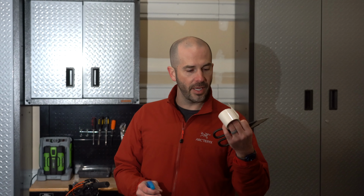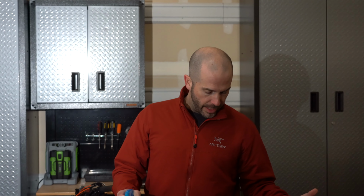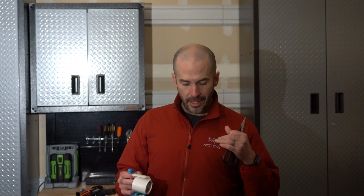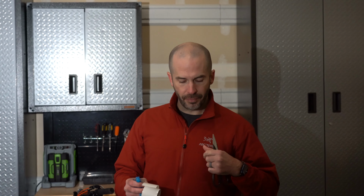Takes a little bit of racer's tape, some alcohol, scissors. You got your bike protected. Takes a little bit of patience. If it won't go on well, use a little bit of heat and just slowly work out those bubbles. The next morning you'll probably come out and you'll see some bubbles in there. Same thing, just gently work those out, and once it's set, it'll be on there for as long as you want. Good luck.